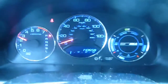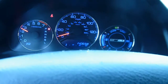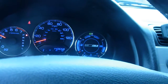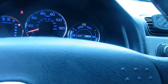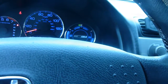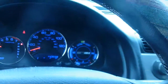I'm still running the engine at high RPM — 2,500. Certain vehicles you don't try to go to high RPM, such as the Peugeot 505, some Volvos, and some BMW 740s — they have a ZF automatic transmission. If the engine is running at high RPM without being in gear and driving, the pump won't work and that's the reason you can ruin it.